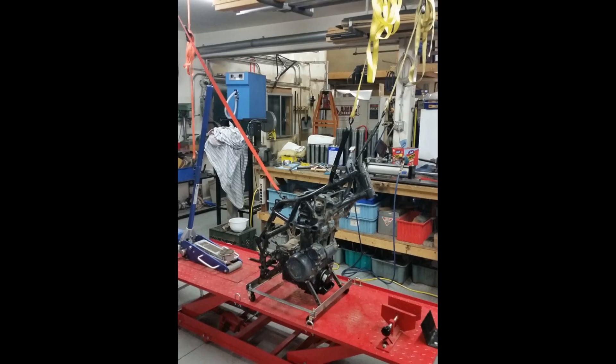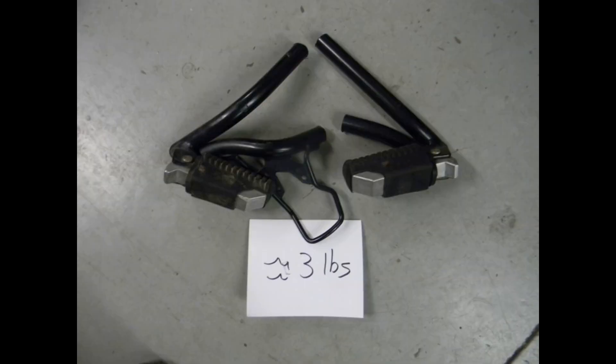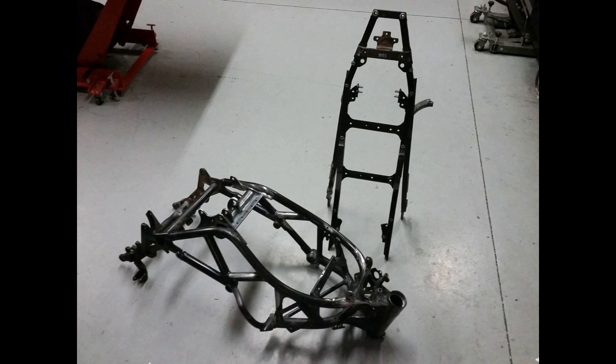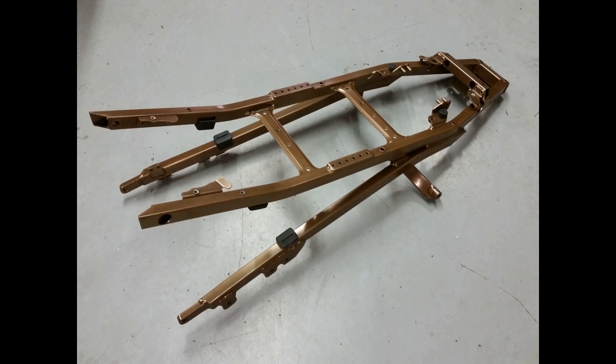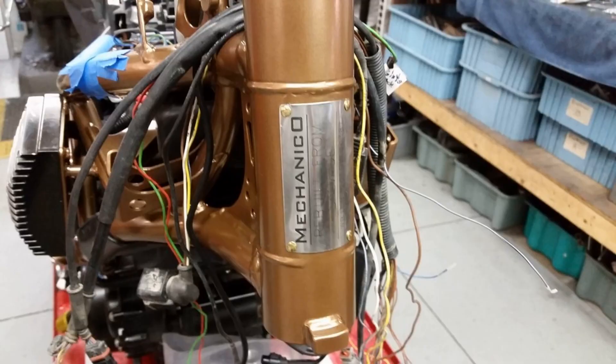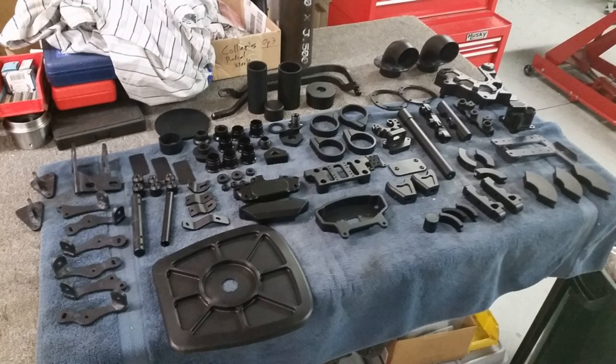With a lot of fabrication done, it was time for a teardown. I took the bike apart, pulled the motor out, put it on the little stand, and even cleaned the motor. Cut off those rider pegs that are welded onto the frame. A known weak spot on the F800 is the upper shock bolt — it is known to bend over time because it doesn't have enough support. So here you can see I welded on a second gusset for the shock bolt and reinforced the frame around that gusset. With the frame and subframe stripped down and all modifications made, they were sent out for powder coat in a nice color of bronze. We also had a custom badge made for the head tube just for you, Mechanico. Other parts were sent out for clear powder coat and a crap load of aluminum machine parts were sent out for black anodizing.